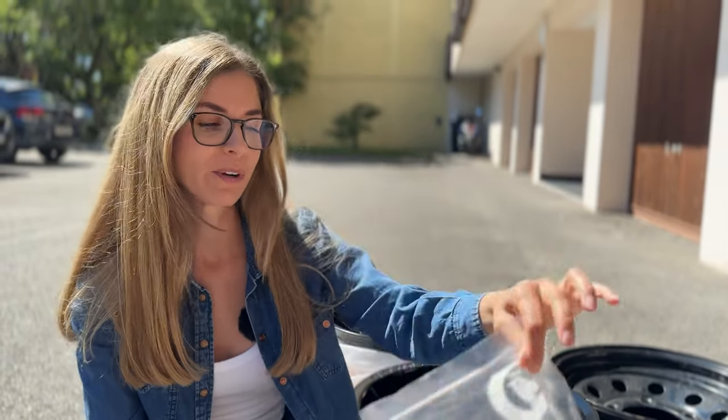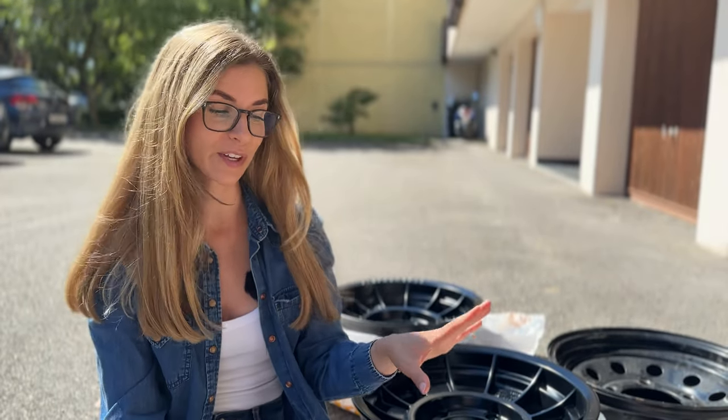As it's the first time we use this type of wheel balancing, we do see some disadvantages. The first is that it could absolutely not work. The second disadvantage we read on the internet is that using these small marbles inside the tire apparently does wear up the inside of the tire, but we're not too sure about that.